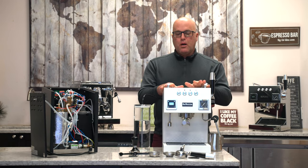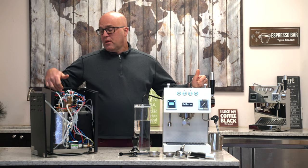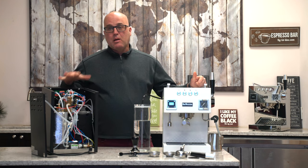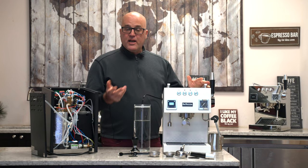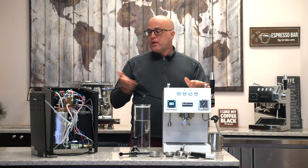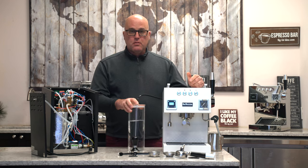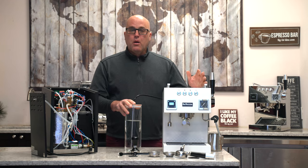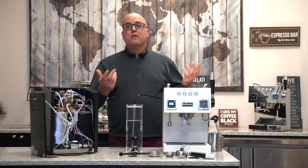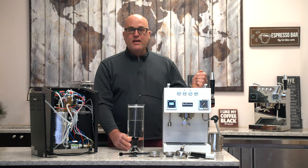The other nice feature about this dual boiler espresso machine — and it's not a boiler plus a thermoblock — is a large stainless steel steam boiler and a large coffee boiler. It's probably one of the largest in the industry in this class of dual boiler machines, which is really nice because more water and larger size means more temperature stability. The warmup time can increase a little because you have more thermal mass to heat up. But a nice feature is the glass reservoir being external. In a lot of machines where the reservoir is inside, the water heats up with the plastic BPA-free reservoir, which can affect your espresso. Being external, it maintains room temperature.